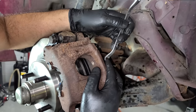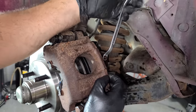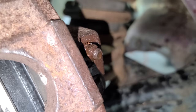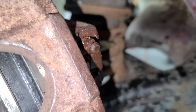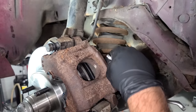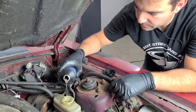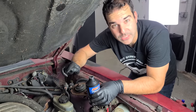You always start with the brake caliper or wheel cylinder that's furthest away from the master cylinder. We've already bled out the other three and we have gotten very, very lucky. Sprayed everything with penetrating oil. Look at how easy - this is so great. Here comes the brake fluid, and for being so old it doesn't look that bad, but you definitely want to replace it. This has probably absorbed a ton of moisture over the years. We're going to suck this brake fluid out with a vacuum bleeder because I really want to drive this car. Next up, we're just going to fill this up with our synthetic AMSOIL brake fluid, and I'm going to save the cleaning of this reservoir for a future engine detailing video.